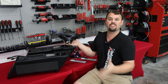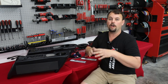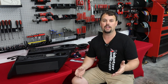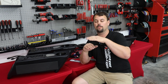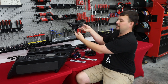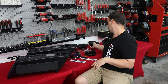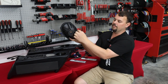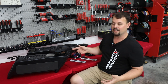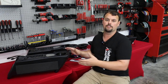It does not touch the bag, so it doesn't rattle, but it gives us the clearance we need to be able to get it open and closed. We also went way bigger than we really needed in diameter, because we know you may have a different brand of speaker. So as long as it's three and three quarter inches depth from the mounting flange to the bottom of the magnet, and up to four inches round in diameter — which allowed us to fit the Infinity Kappa Perfect, as you notice they have a really odd shaped basket on the bottom — even that will sit down in this cup and allow us to clear. Your 6x9 is going to fit with these enclosures.